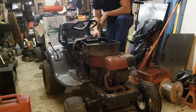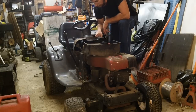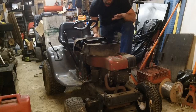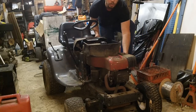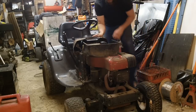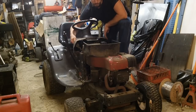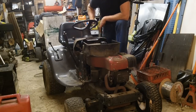Well, let's see if it'll actually kick off. Now, when you do these Craftsmans, you've got a setting that comes up to where it runs. You push it forward and you should actually see the choke lever move. Let's push it forward and watch for the choke — yep, it moved. Let's try it. All right, so the battery's dead. Let's hook up a booster.